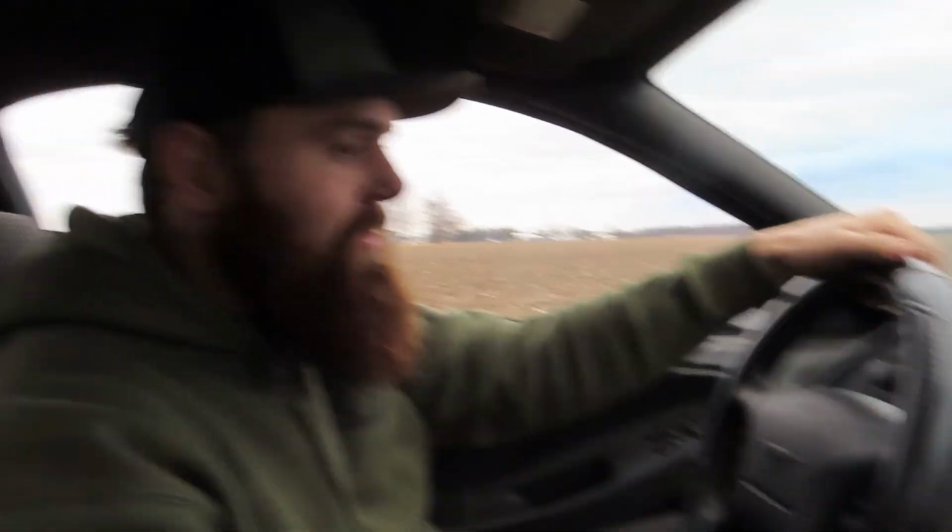I'm very thrilled there. I'm excited to see what the bigger jets are gonna do, because these are just the jets for 35 horse. We have jetting for up to 200 horse, so we're gonna work this thing up in a couple of steps here, but I am pretty happy right now. Our draggy here, so we're gonna do the same technique. As soon as we get rolled into about 3,000 RPMs, I'll hit the nitrous and away we'll go. All right, you ready?